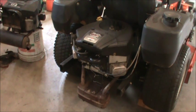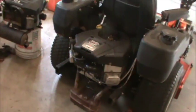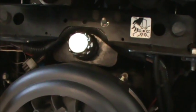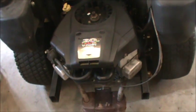The next thing I needed to look at was the physical size of the engine — is it going to fit within the frame of the tractor? These Briggs overhead valve engines from 18 to 26 horsepower are all the same size block, so I could have gotten any engine from 18 to 26 and it should physically fit. As you can see, this thing is a pretty tight fit side to side. Right there where that silver cap is — that's the hydraulic oil reservoir — it butts right up to the block, so I have maybe a sixteenth or an eighth of an inch clearance.